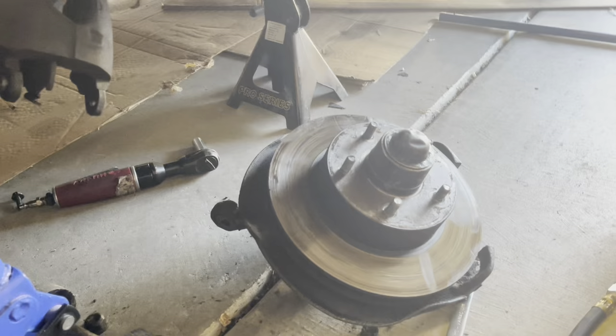I just put the spring in there. The flat part of the coil goes on top. You see that spring over there — that is sitting the correct way. You see how at the bottom, that part of the coil is farther away? That's the bottom. The close part on top is the top. And then you want to make sure that the coil on the bottom lines up with the ramp. Now up in here, you want to make sure that the spring is lined up with the fingers. Make sure it's sitting properly. Right now the fingers are not lined up, so you want to double check that and make sure they are.